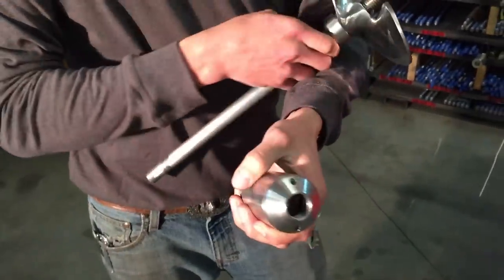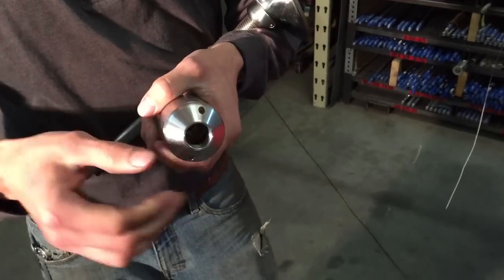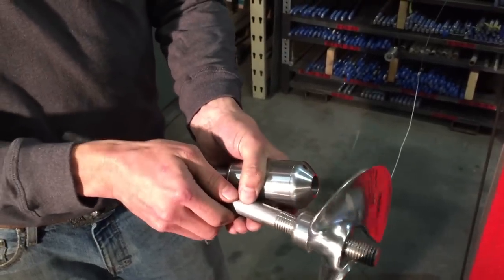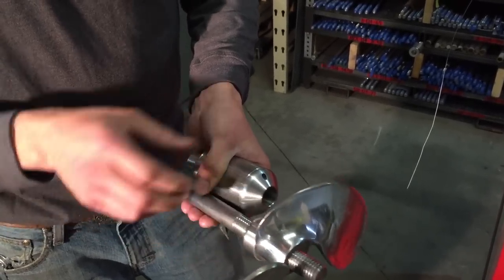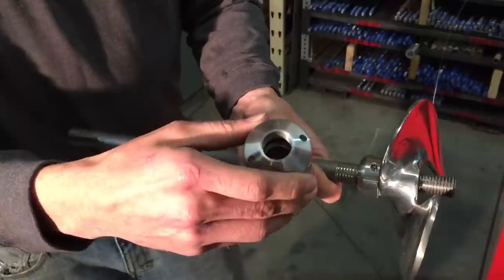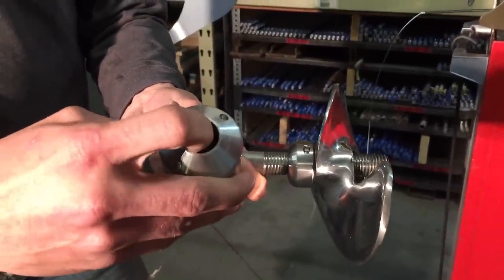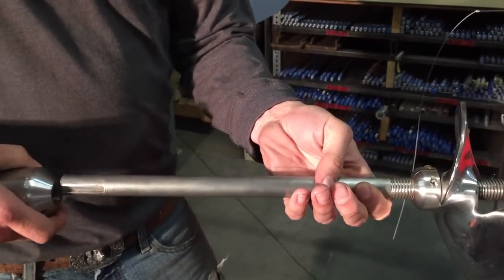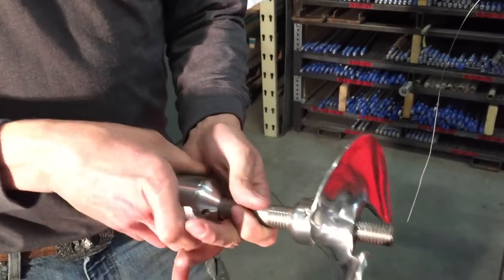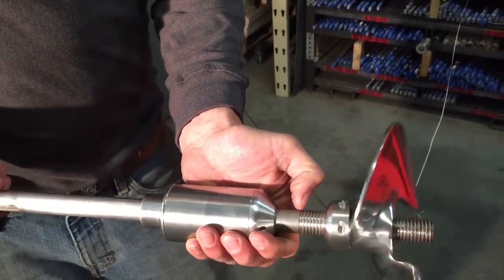Now this is where we actually get into our Revel Clean bearing system. This cone shape here is going to funnel water down to your prop, or direct water down to your prop. Inside of that bearing housing cap, the cone, there's a half inch area, that flat surface right there, that has a tight tolerance to this 3/4 inch drive shaft. What that does is that rides over top our Revel Clean groove.